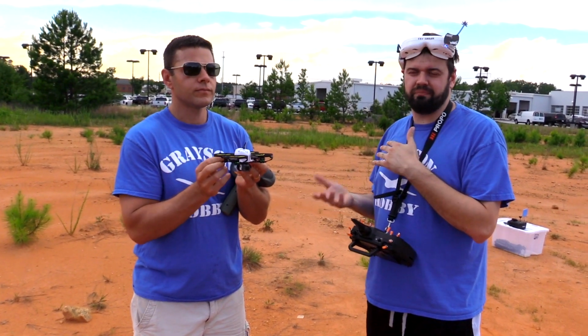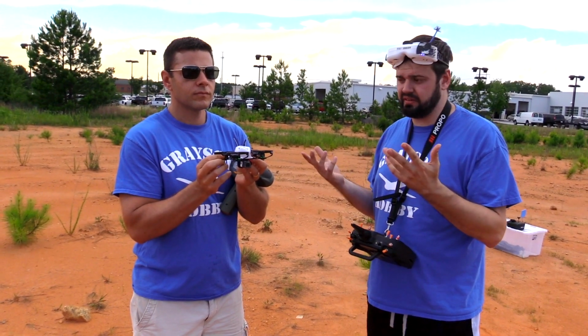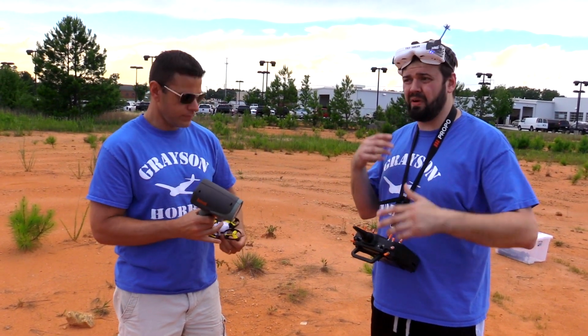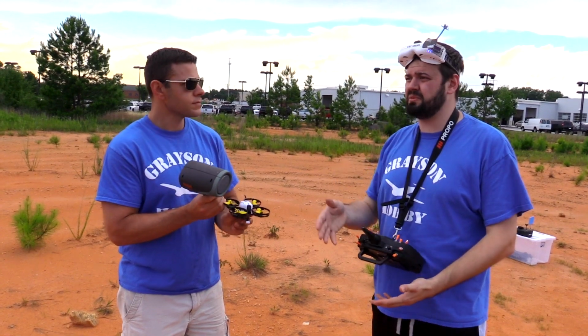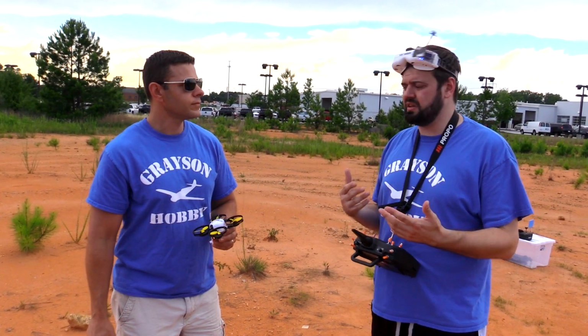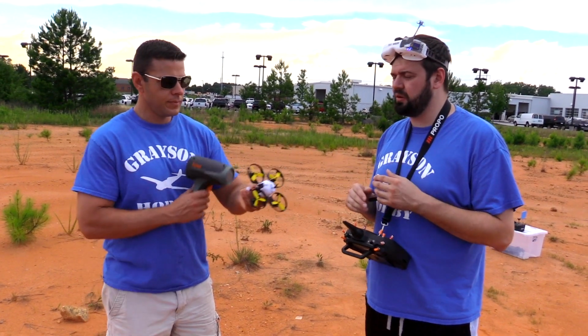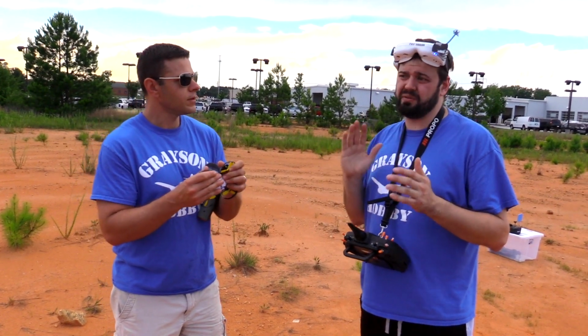Anyways, PIDs were really set up this one. I updated to the newer factory PIDs or whatever, and I changed a couple things. It was actually flying really good on 2-cell, but I'm not really doing full passes with this one. I'm doing more proximity, so I think the PIDs were a little low for straight ahead. I think the I gain was a little low, but as soon as I started going on this thing, it was like it was ice skating.